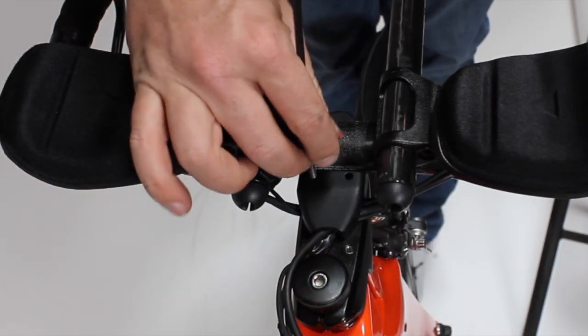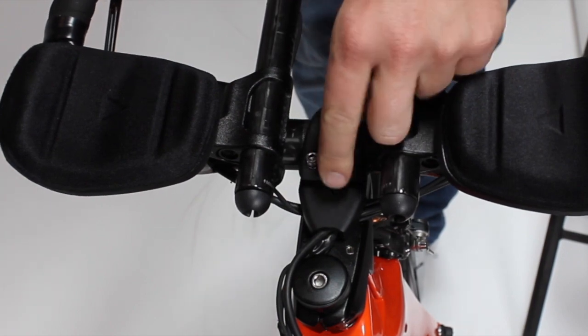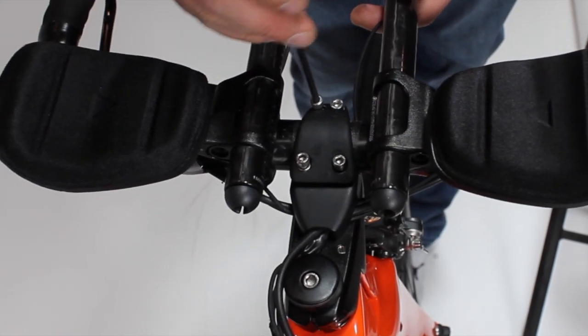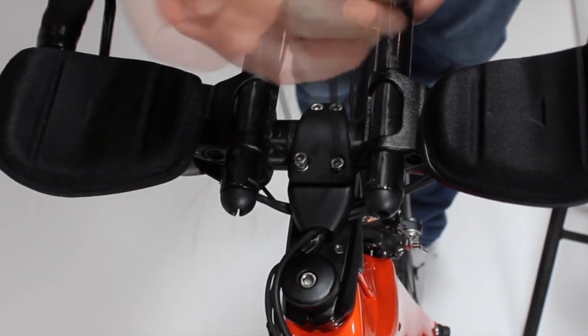Then remove the rear clamp bolt. Reinstall this bolt with the clamp in place and the rest of the bolts. To ensure you have equal purchase in all bolts, start the threads with 5 turns each. Then torque your bolts down to the appropriate torque specs.